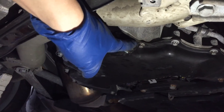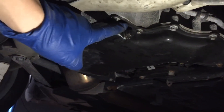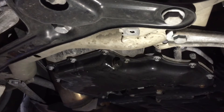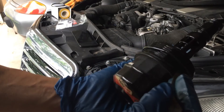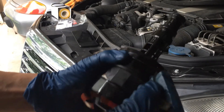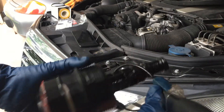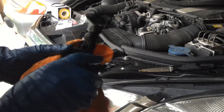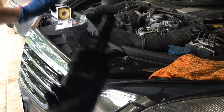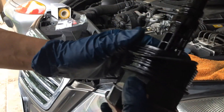The oil drain plug hangs off the side — on the driver's side. Sorry for the shaking camera. Remember, it's always good to change out these O-rings. If you don't have any special tools, you can take a knife and get it out that way. Before you slip the O-ring back on, put a little bit of oil on it — it'll help it roll back on easier.